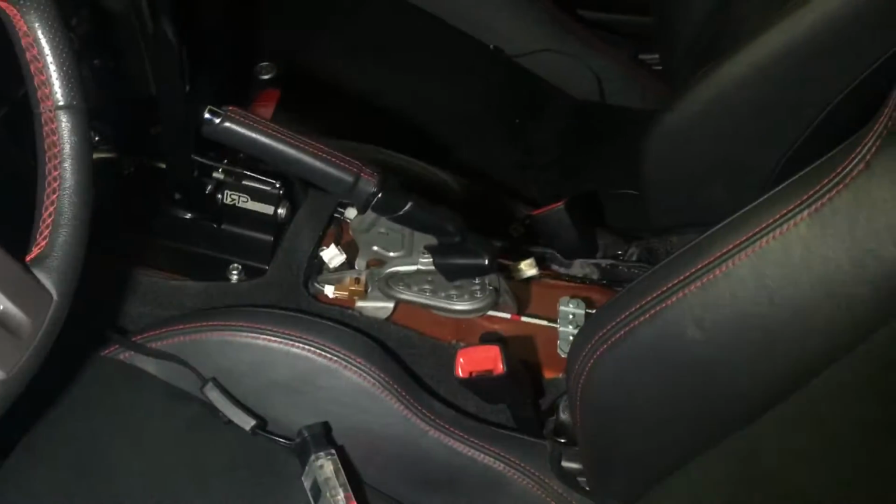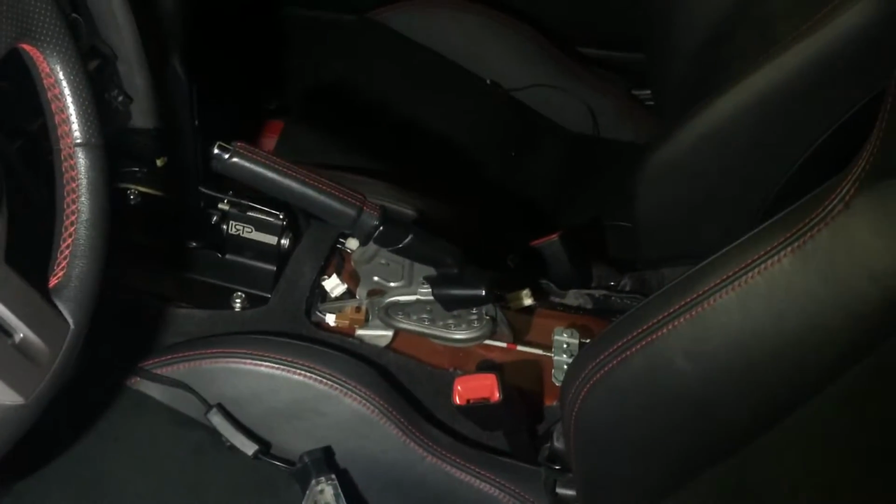in the car. You shouldn't be using any power sources when you're flashing, so make sure your headlights are off and your AC is off, and if you can turn your radio off, turn it off. This one can't be turned off. And that's it. And don't open or close any doors, hence the open window and being outside the car.